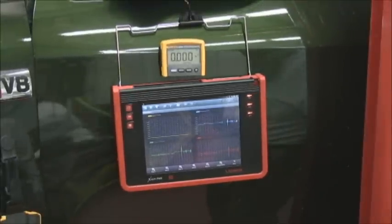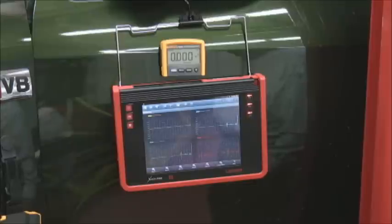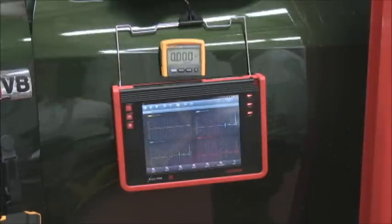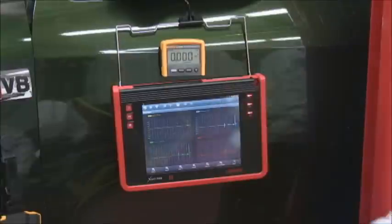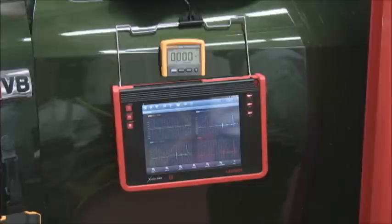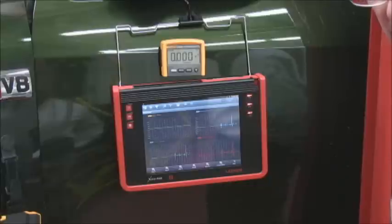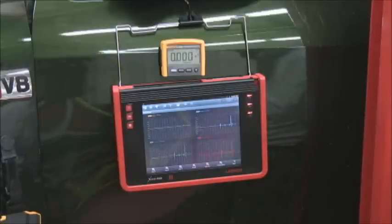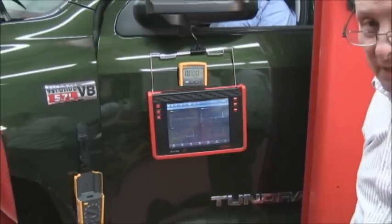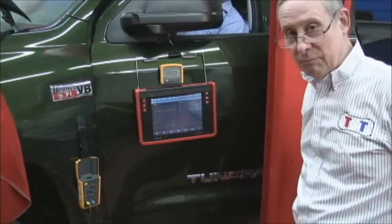A big question asked is: how come I can't use my amp clamp? The answer is it's too low a number — it's so small that the amp clamp just can't read down at that level. The interference from your shop lights is more. Not to say you can't buy a very expensive amp clamp that reads in micro amps, but there's no need for that. Even then, with all the interference in a shop, you might have problems getting an accurate number. Those things usually clamp tightly on the wire instead of just having a whole sensor around it — probably not a good thing for the shop.